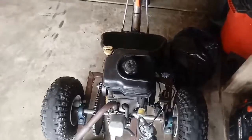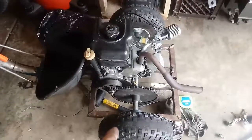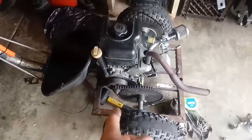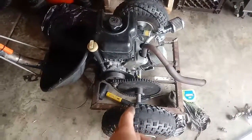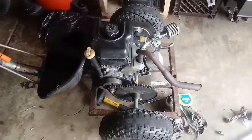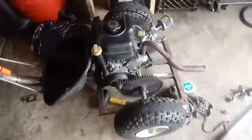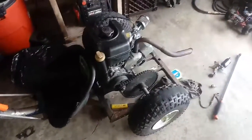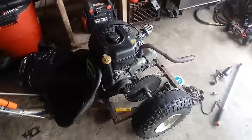But yeah, I'm going to get a 48 tooth sprocket so that the gearing can be 4.8 to 1 because that's a 10 tooth clutch. And right now that's a 60 tooth sprocket, and that's good for drifting. I'm probably not going to be able to drift with the new one, but at least I can drive it on the street and keep up with people because they're always trying to go so fast. But yeah, the blow-by has not gone away. It's still got a lot of smoke, but other than that, it's pretty much driftable, I guess.